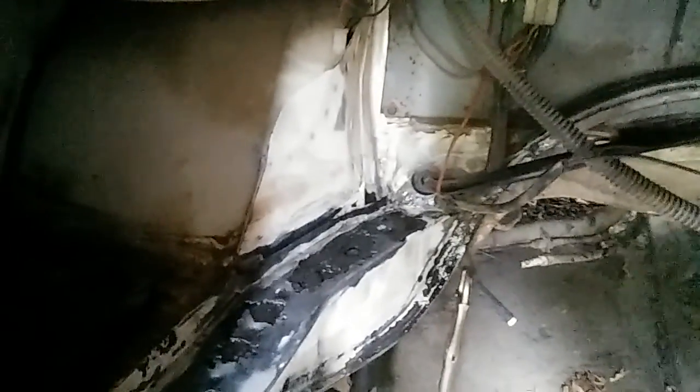So I just used a paint brush and applied it all over the places where there are rust. You can see it's on there now — it's looking really great, it's cleaning up nicely. You're not seeing so much brown, you're starting to see the metal again, so the phosphoric acid is doing its job, it's eating all the rust. We had quite significant rust as well on this side going right into the frame, but as you can see the phosphoric acid is just completely taking away the rust and leaving just the bare metal, which is great.